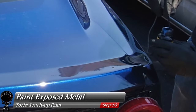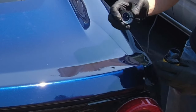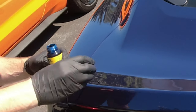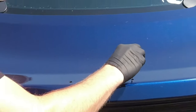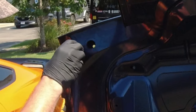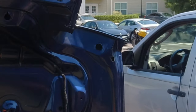After a few minutes have passed and the alcohol has dried up, now we can grab our touch-up paint and paint over all that exposed metal. The whole idea is rust prevention, as well as maintaining a nice clean appearance on your car. Take your time — there's no rush. If you do get any spillover, no big deal; just grab your microfiber cloth and clean up any excess paint. We'll do holes five and six on the outside, then open up the trunk and do the ones on the inside, which require a little bit more paint because there's a little bit more exposed metal. We'll work our way to the passenger side and do the same thing.